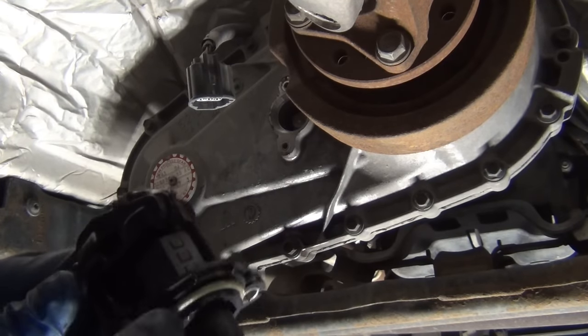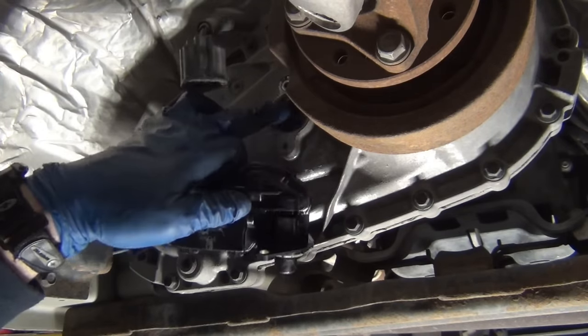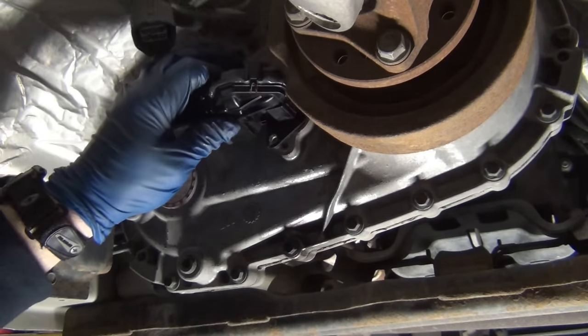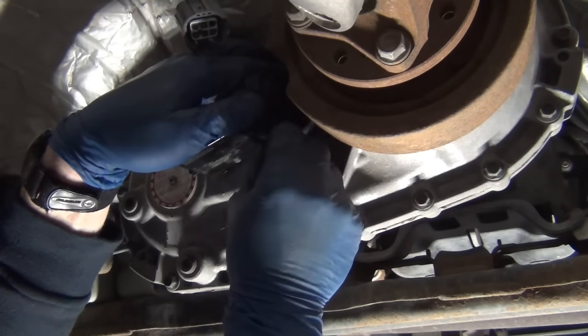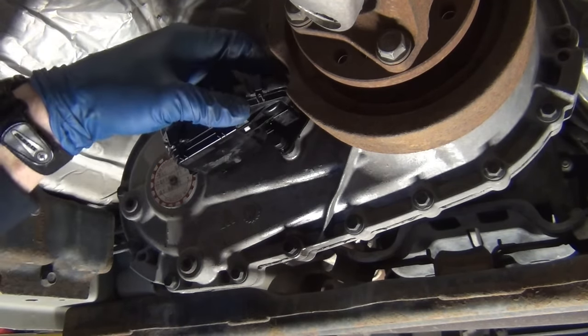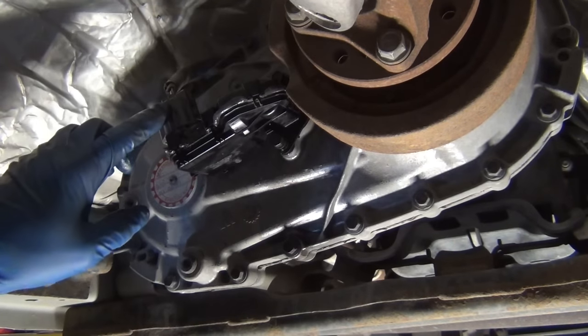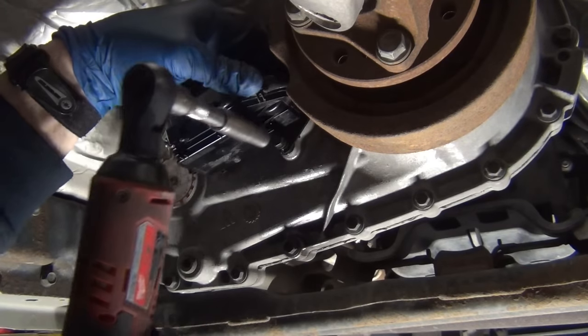Let's take a little transmission fluid and put it on the o-ring here — that way you don't get any binding. You can see that this is kind of beveled or sloped to help make things smooth. You'd be hard pressed to mess this up. It's hard to find where the first thread is, but once you've got it, you've got it. Like I say, if you want that serv four-wheel drive light to turn off, pretty much all you've got to do is unplug this thing. If it doesn't work, do it a couple more times and it seems to clear it.